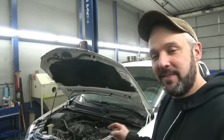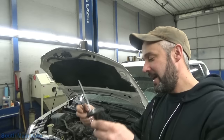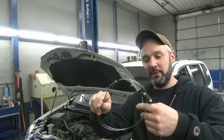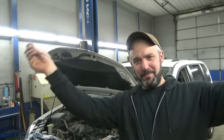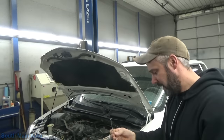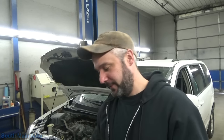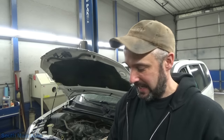It's got that 62TE transmission, and it has no dipstick. You've got to have this little guy here — I think Miller Tools makes it. It's the big jabroni dipstick with the graduations on it. According to the instructions, when you do these, you've got to look up the fluid chart and the temperature range and plug in your scan tool — because they didn't put a dipstick on it.